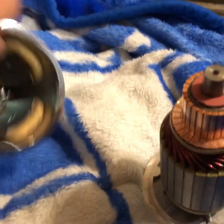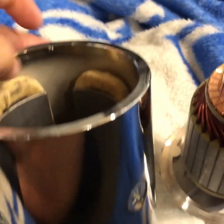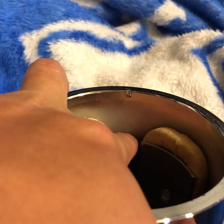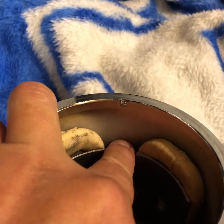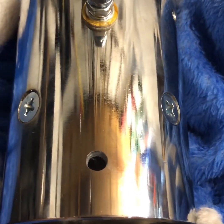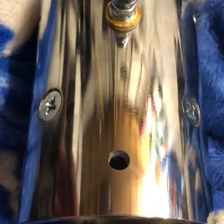Now you're gonna see your positive post right here, and you're gonna want to drill a hole in between right about here, just big enough for the bolt to go through and secure itself. Now that I've drilled the hole through, it should be pretty much in line with your positive post and should look something like this — in between the two.